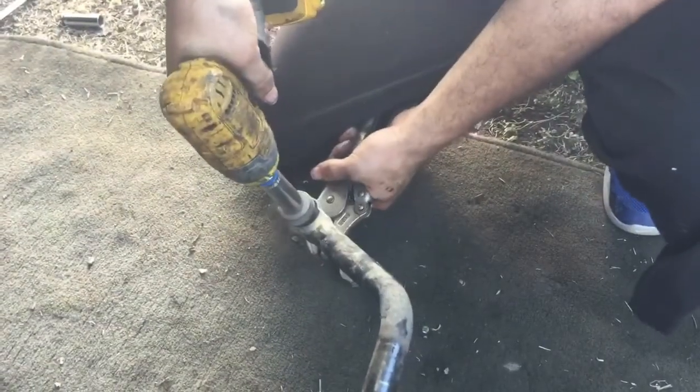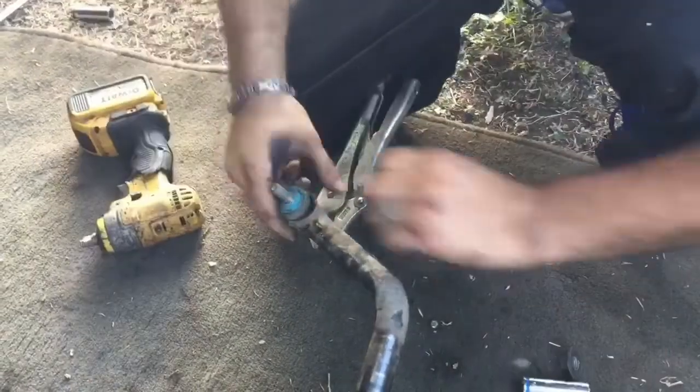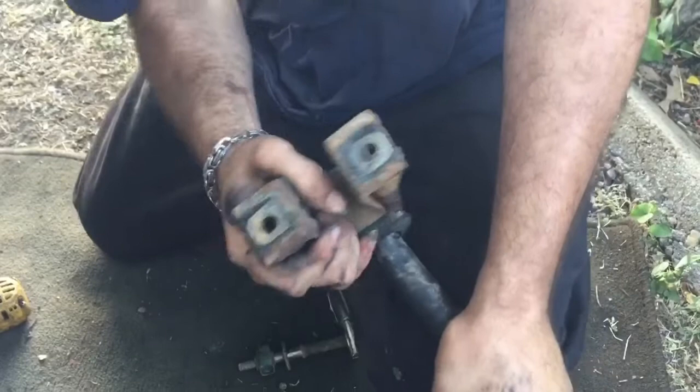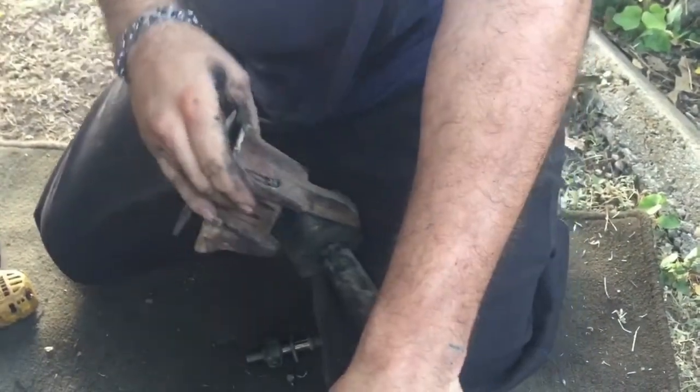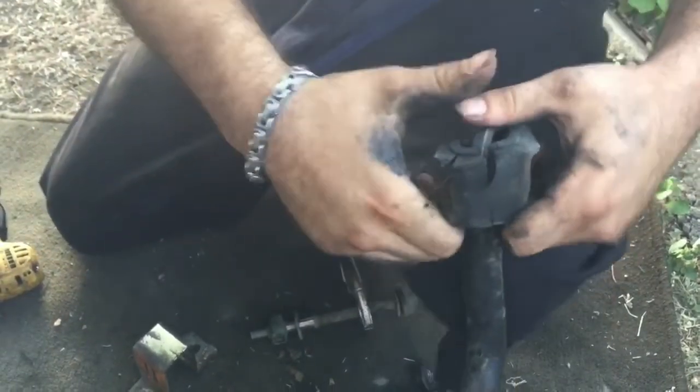As you can tell, I've got my vice grips already pinned down and I have a socket. Like I said, if you guys have power tools, this thing is so much quicker. And it pops off — bushing comes out, there goes the rod. And out pops the bushing. This one's a little torn out, but it will pop off. And that's how you get the bushings out.